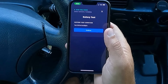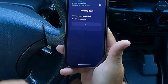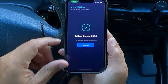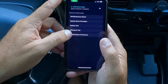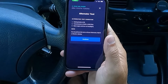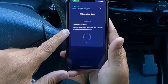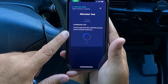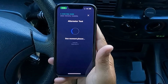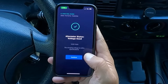Now it says turn on the headlights — they're on, so hit continue. It does a little countdown. Now it says turn off the headlights — they're off, continue. It says start the engine, must be started within 30 seconds. Started it easily. Battery system: pass. Now we can also test our alternator — let's do that. Parking brake on, transmission in park or neutral, start the engine and turn on the headlights. Do not perform this test on a smart alternator, hybrid, or electric vehicle. Now it says increase the engine speed above 2000 RPM and hold until the countdown reaches zero. Now it says turn the headlights off and return to idle. Alternator status voltage: good — 14.03 volts. Charging voltage is within specifications.